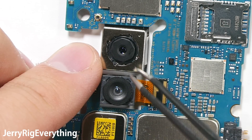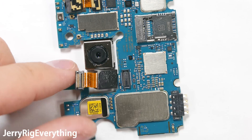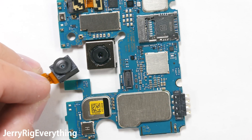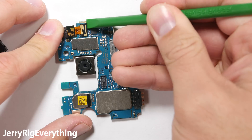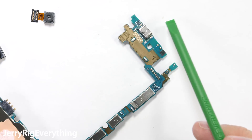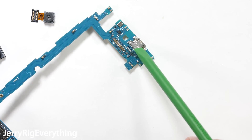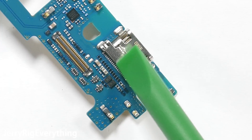I'm going to check out the motherboard before putting the phone back together again. You can see the OIS stabilization on the regular rear camera lens — the wide angle lens does not have the optical stabilization. Each of the cameras can snap off like a little lego piece, but unfortunately the charging port is permanently soldered. So if your charging port breaks, you are out of luck unless you have a micro soldering station and some major skills.